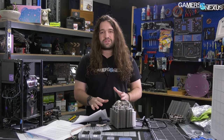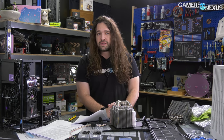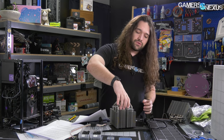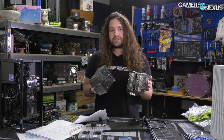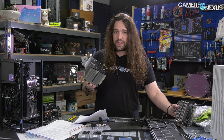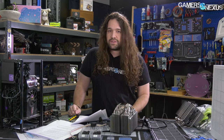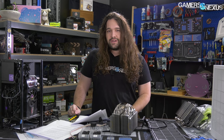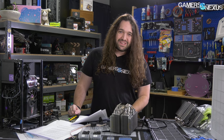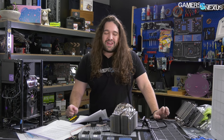Our reviews process looks at quality of mechanics, installation difficulty, cold plate flatness, pressure distribution, thermal performance, and acoustic performance. The Ninja 5 costs $60 on Amazon in the US, the same as the Fuma 2. It does run a much quieter fan because it's much slower. Other competitors in the large cooler class include the Noctua NH-D15 at $90, the DeepCool Assassin 3 at $90, and the Corsair A500, which used to be $90-100 but is now around $27.